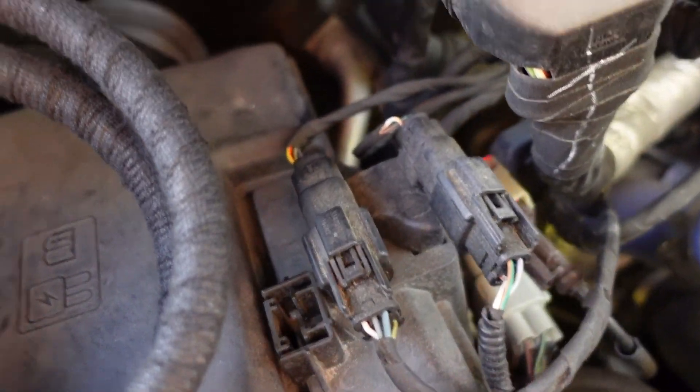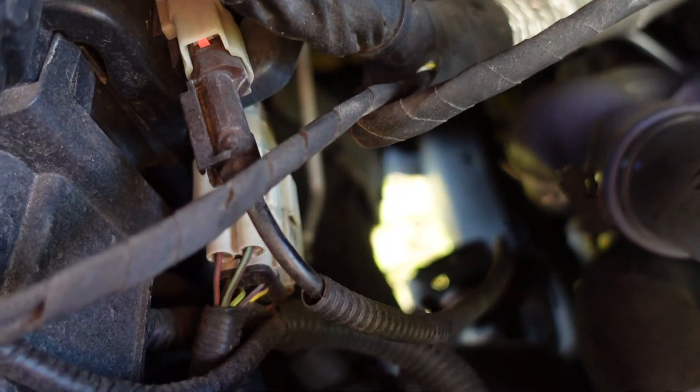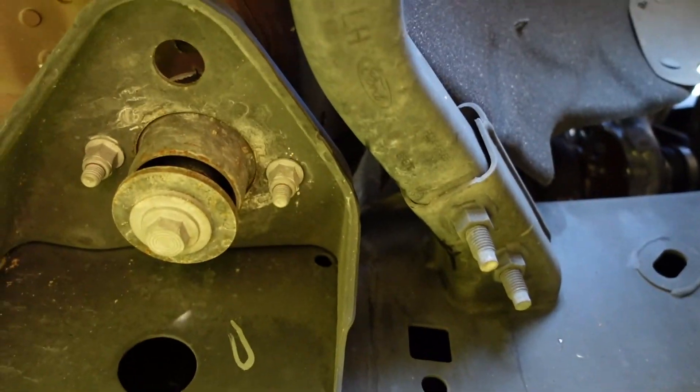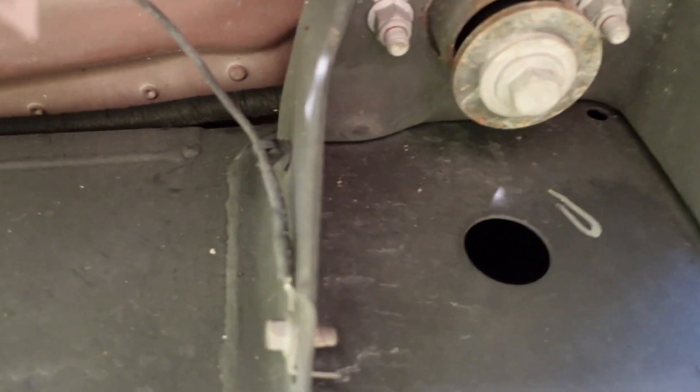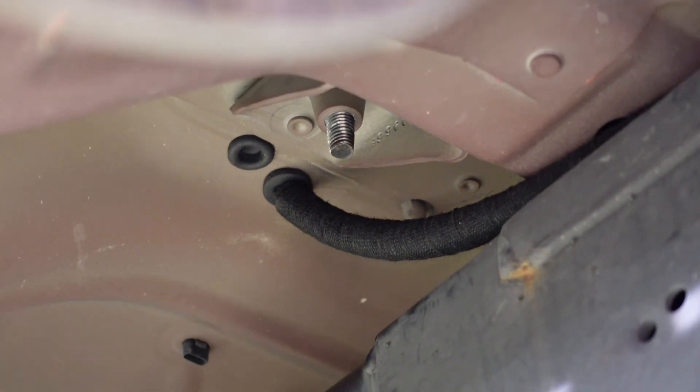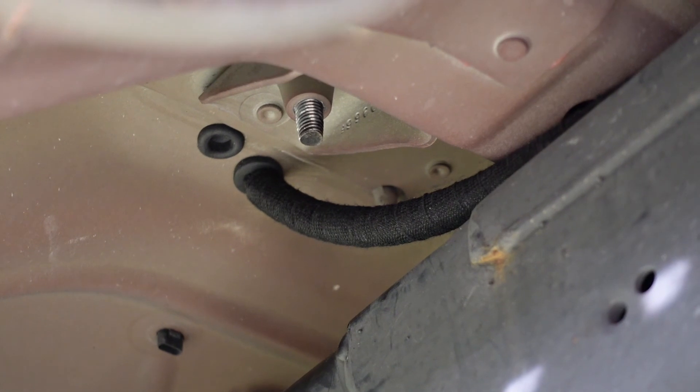We've got a kind of a loop here with some excess wire, and we're going to go down the left side of the engine compartment. We'll go down and come out through the bottom there, coming under the truck. You can see it tucked up right there. The wire runs this way, tucked right up in there. It's going to run back, and over here we've got one of the seat bolts. Right behind it you can actually see where I drilled an original hole that was not in a good spot — I'll tell you about that in a second. Then I had to drill another one to the right of it, and we've got some rubber grommets going through there.